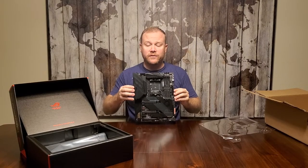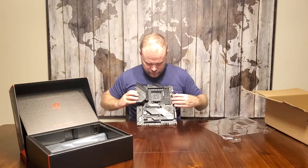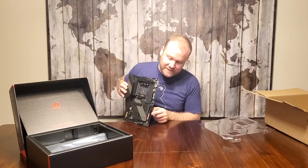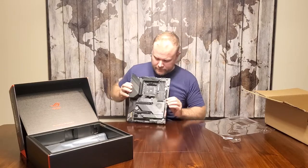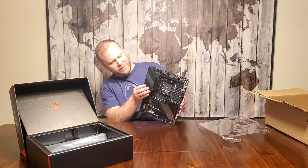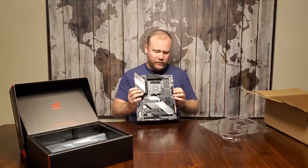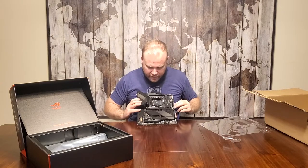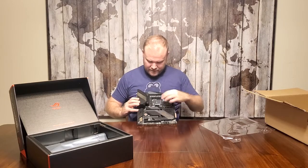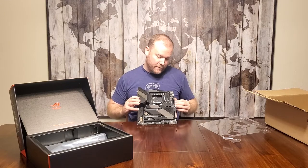It's not a light motherboard, I'll tell you that. In terms of the M.2 slots, here's one, here's two, three PCIe 4.0s — tons. You can get eight SATA ports here, all your modern amenities when it comes to turning things on and off. I believe there's dual BIOS in here as well. There's BIOS flash and clear CMOS right there on the I/O, which is great for overclocking. Little start button there. This is a great board — you've got your fan for the chipset, and all your VRMs have heat sinks on them as well.